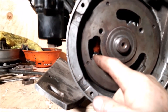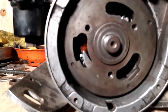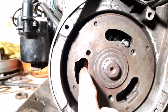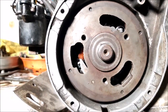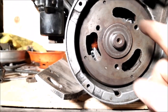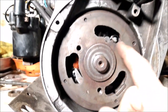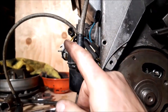The light goes in between the power of the battery and the one coil wire. You do the top set of points first with this little guy here on these older engines — this has to be wide open, you have to hold the advance all the way open. You can see this actually moving in the window here. When this mark comes around up to here, that light should dim if your stator is right. I do 16 thousandths of an inch when I'm setting these — 16 thousandths of an inch, that's what I set my breaker points at. Set the top set of points to open, and once you get those 16 thousandths, I do the bottom 16 thousandths as well. Then I take the wire off one set of points and move it to the other set of points to adjust the bottom ones.